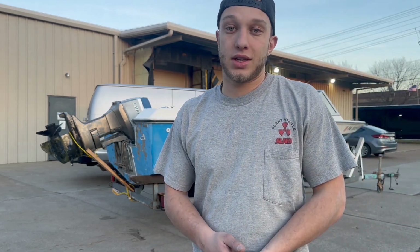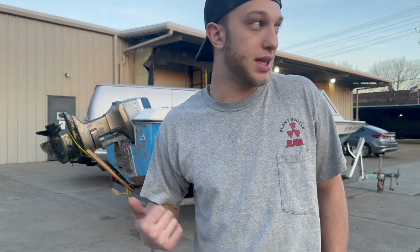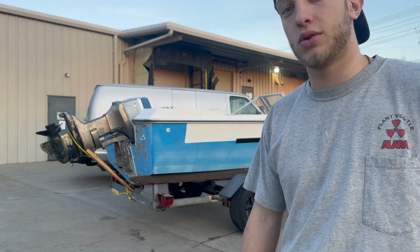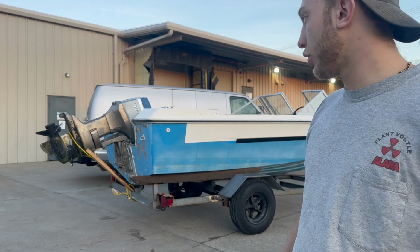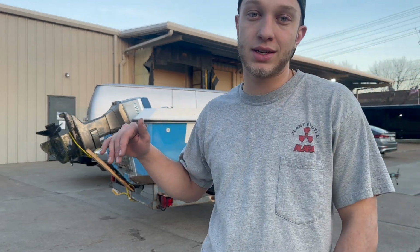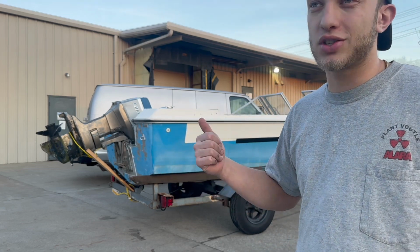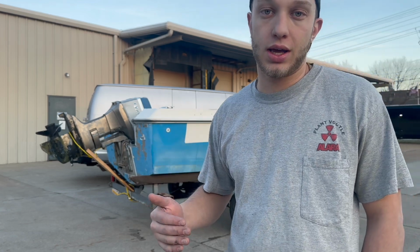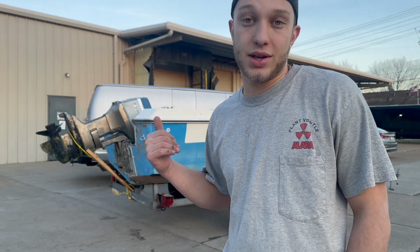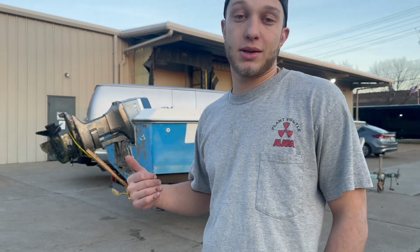Now that it's over, I'm going to actually go out on the water with my roommates, see if it floats, see if it works. Is it worth putting more money into? If that's the case, then we're going to start the second phase of bodywork, which will include some polyester structural resin that'll be able to fill in some of the deeper gaps in the fiberglass that I didn't quite get in the first coat. And then for everything that's already pretty good, I'll put some Bondo on it. Going to have to sand the boat a second time and then a third time to get the finish that I'm looking for. But it's going to be worth it in the end, and I want to do it the right way.